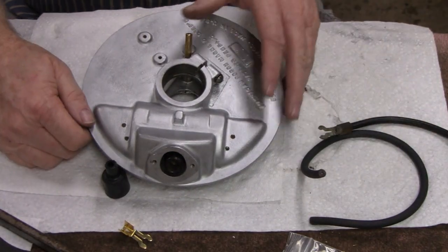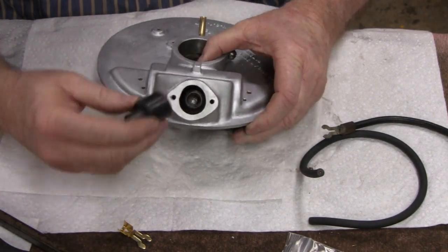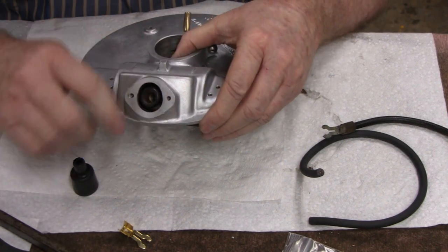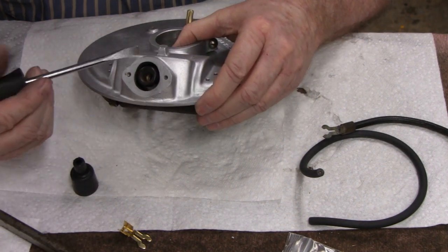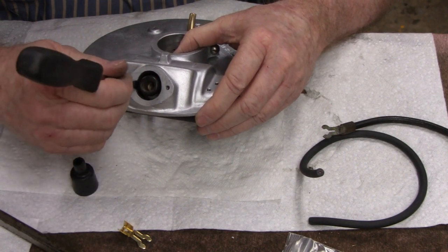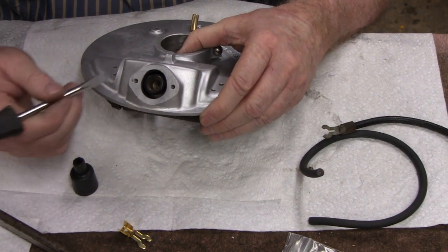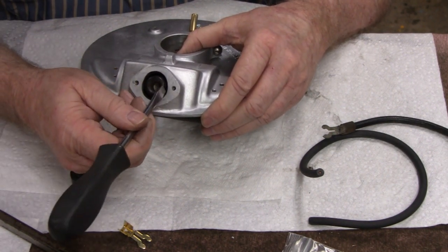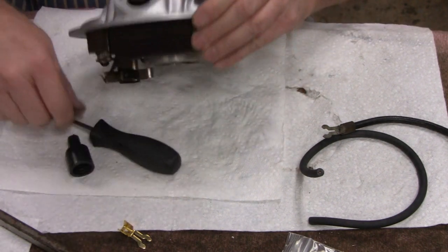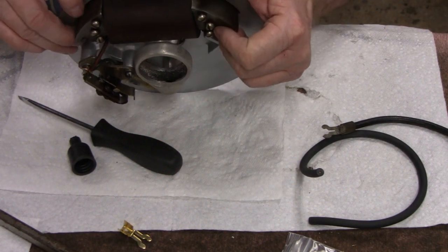Okay. I was trying to do a little fitting here, and I'm taking a boot. I tried to put the boot on and I can't get it on because the coil is almost touching over here. There's a big space over here, but over here is hardly anything. What I'm going to do is take a Dremel or a die grinder and just cut a little bit away. I even loosened up the coil here, but you really don't have any play in that.